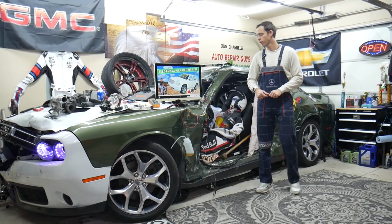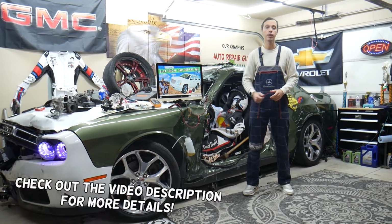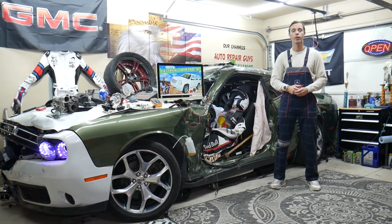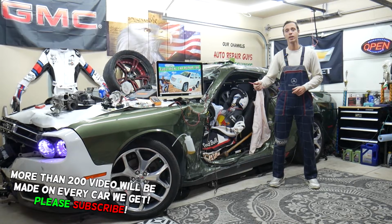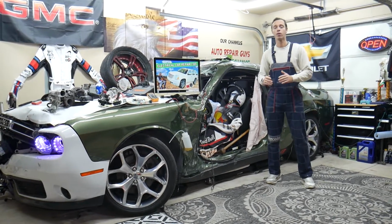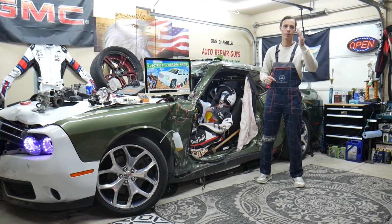Today will be a super helpful video for any of you having a GMC Yukon or Yukon XL of that generation, from year 2007 to year 2014. If you have one of those and you have a problem where the GMC does not start, does not crank, stay with us, we'll explain what you need to check. You need to check up to 15 different fuses and relays. Always start with that. It could be a super simple fix.